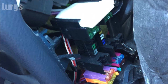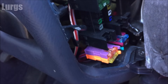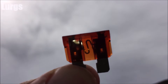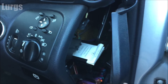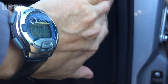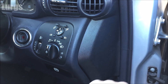There's a link above about how to test fuses without having to pull them out. If you're lucky enough to have a good previous owner, you'll still have the fuse allocation diagrams, which I'll show you later. You can pull each fuse out and hold it up to the light to see if it's blown — this one is perfect. Just put the panel back in gently; it's just a few clips, give it a pop, and that's done and dusted.